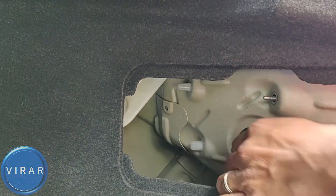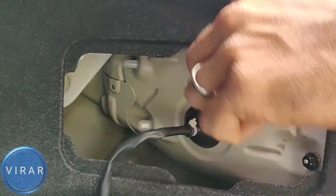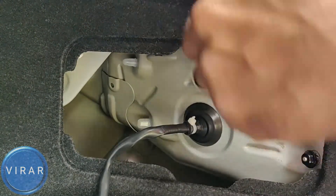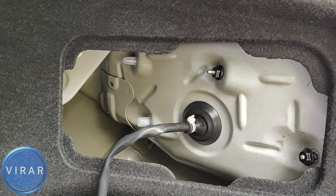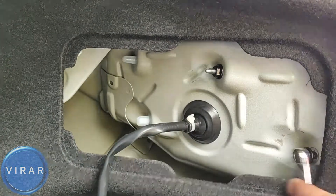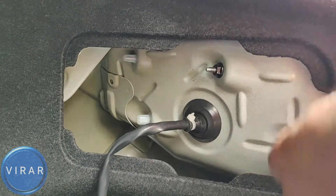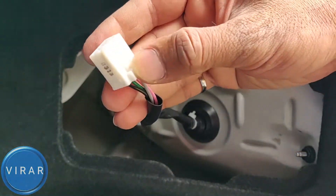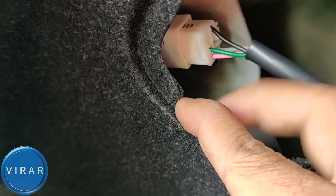Push it in a little bit, get the wire, and put the nuts on. When you tighten the nuts back on, you may feel some resistance because we hammered on those threads and there may be some deformation — but you'll be fine. Get the wrench or socket, tighten those nuts, then push the light in and tighten them all the way. Now let's put the electrical connector back — it only goes in one way, slide it in and click it in place.